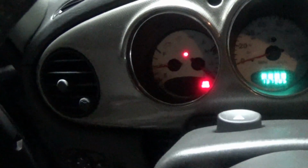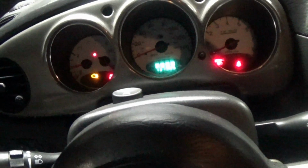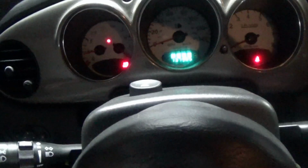Because I forgot to show you guys before in this video, I'm going to show you what happens when I turn the key. No fuel pump priming. Everything's lighting up fine, but then that light comes on, and these light up all together. All the gear selectors light up solid, which is really weird, and it should not be like that. It should just show park. After a little bit, the airbag light comes on, and then all the normal lights, and it beeps, but it's definitely acting weird. When I do the key dance, usually you can go 1, 2, 3 with the key, and you'll get any fault codes pop up at the bottom of the gauge cluster. But when I do that, I don't get anything. Something is messed up.